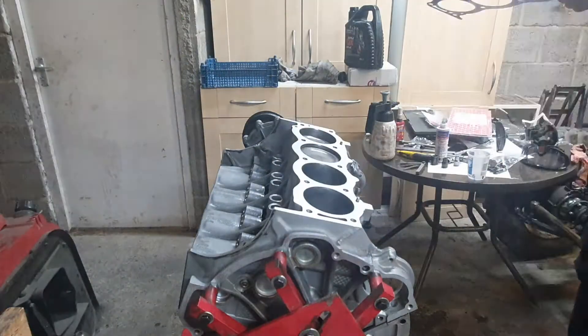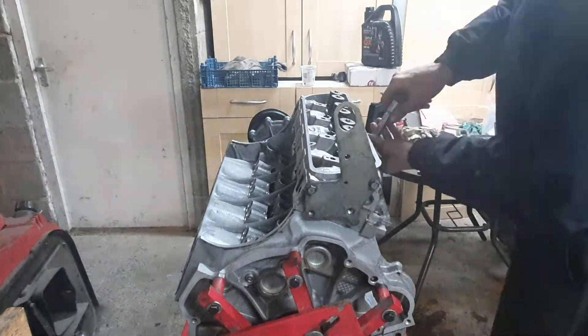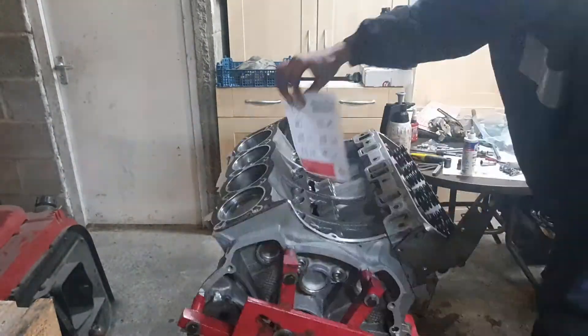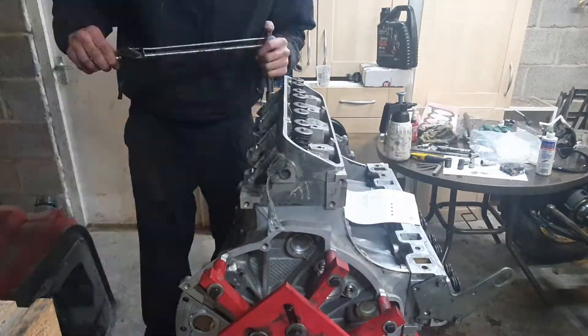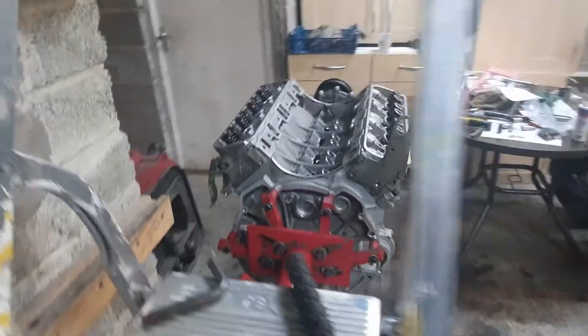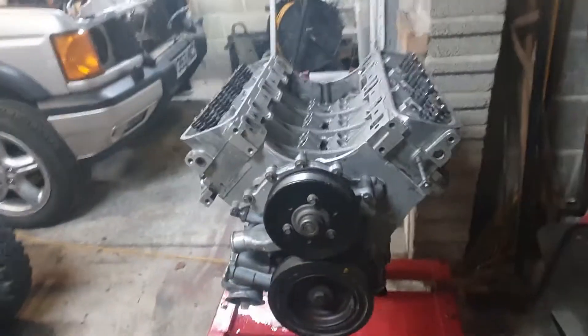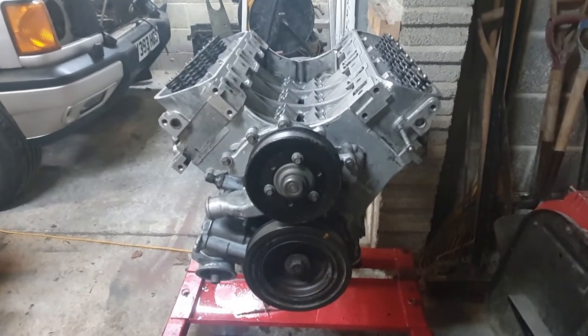Let's get those fitted then. Gasket on - I'm not quite happy with that so I trimmed it with a file, just to move it left to right a little bit to better align with the cylinders, then in with the bolts, tighten them down by hand, and I've done the torquing in sequence before moving on to the second head. The gasket fitted better on this head so straight on it went, same with the bolts, torqued them up. There we go folks - ain't she sweet - all in its V glory.